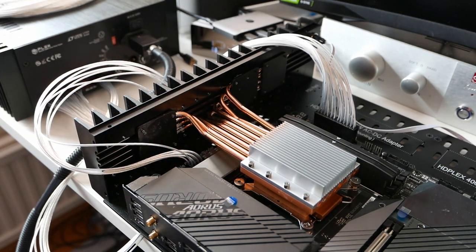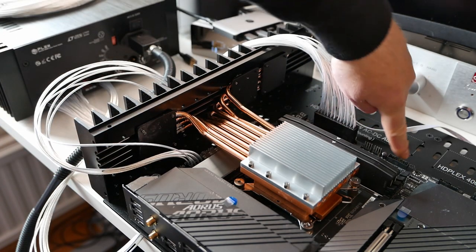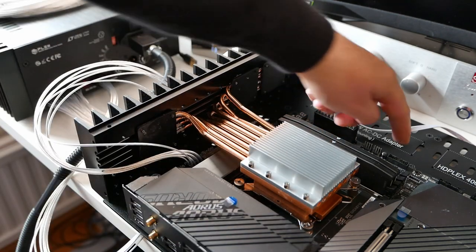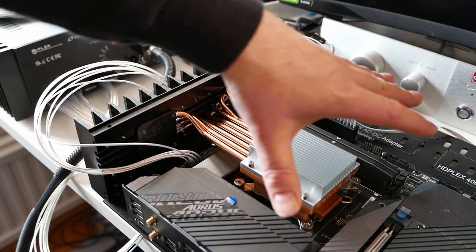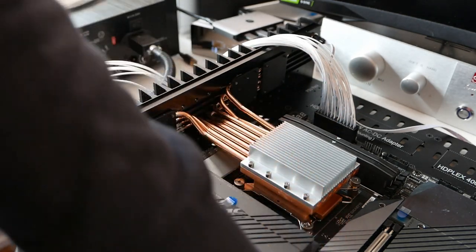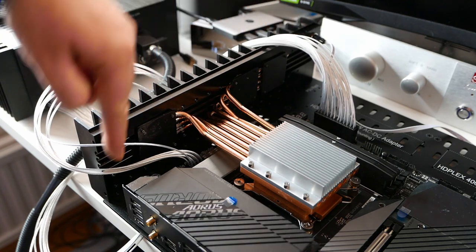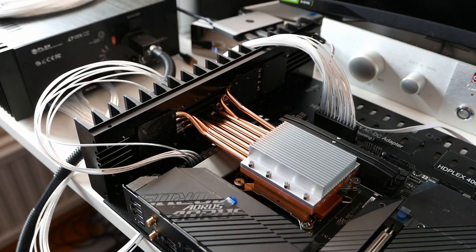Now what you do with those little screws is you just screw them into the spots on the base which are marked. But what you can do is put your motherboard down and then just line them up. Your motherboard has screws on each corner, and then it'll have some others on the sides. You can make sure that if you've screwed them in, they're actually in the right place. So it's pretty straightforward. But as I say, making sure that you've got the right height is really important.